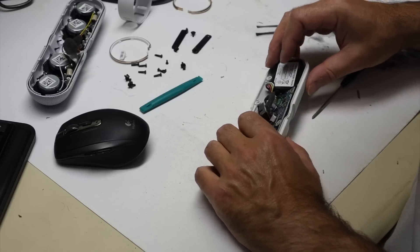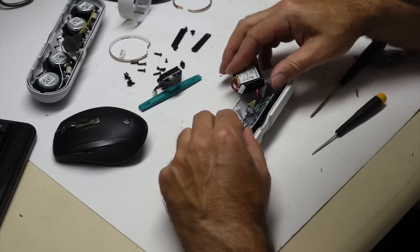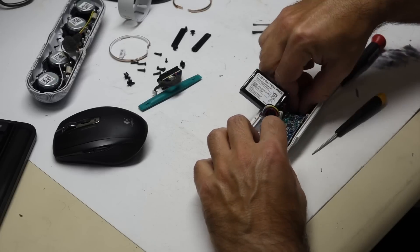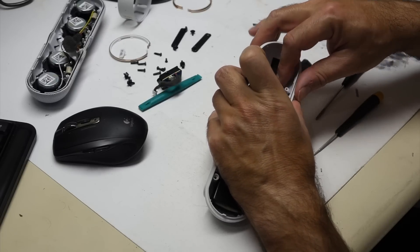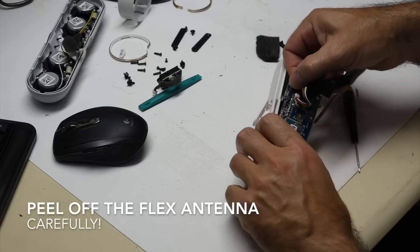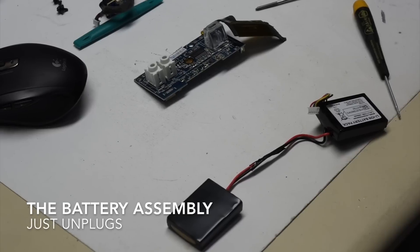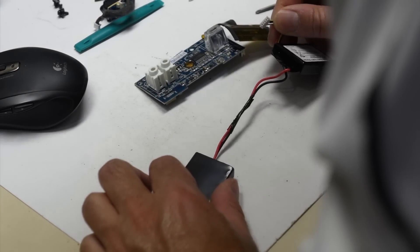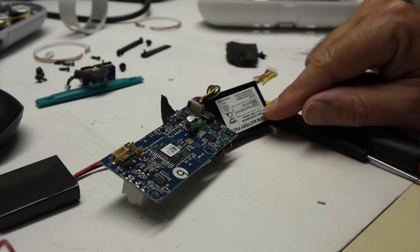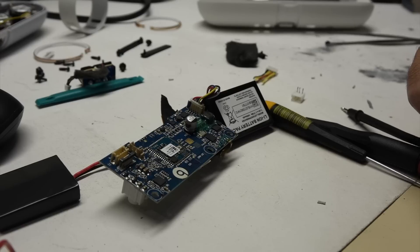There's flex in there — and there's a flex at the bottom, which is the antenna. Antenna unglued — success. So the battery comes apart as one unit. I could have tested it on board just from the connector. It's 7.4 volts, 1050 milliamp-hours — two of them. I don't know if they're in series or parallel. It's weird that both would go bad at the same time, so I'm wondering if the charger circuit is bad.